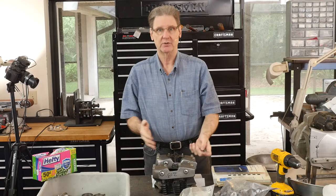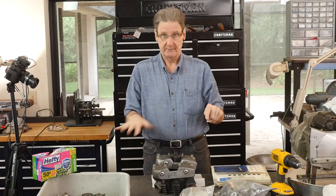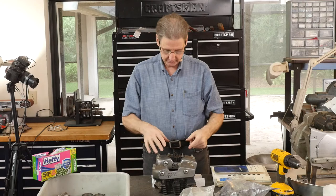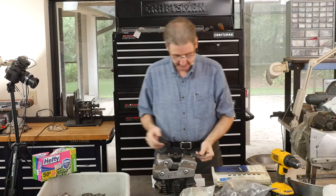The reason this whole system is so bad compared to '76 and earlier — by holding the rocker box bolts, it wears out the rocker box gaskets from vibration, especially if you get loose bolts down in your motor mounts. Then this stuff starts shaking and you get all kinds of oil leaking out. On the rear one, you can't get the rocker box off. I hate silicone — if that gets in the motor, you could burn up your motor.